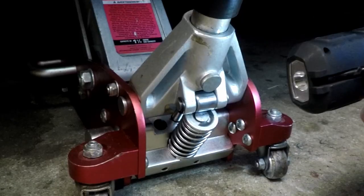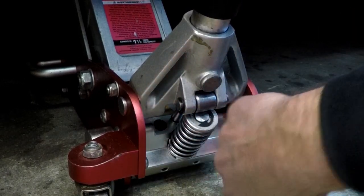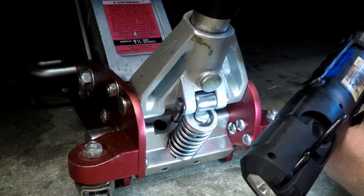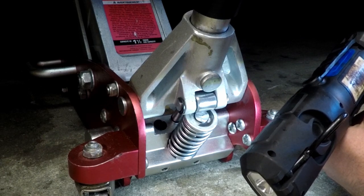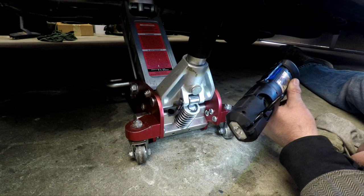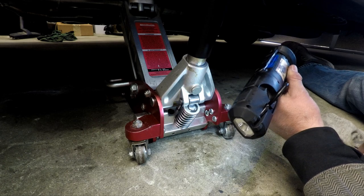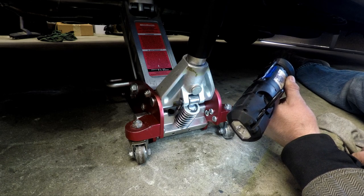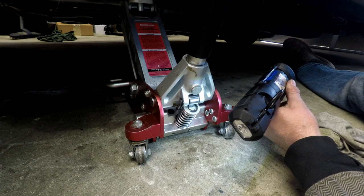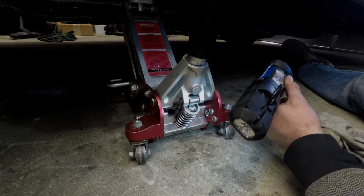It's the next day now — just kidding. Looking at the area again under some real focused light, I don't see any leakage — none whatsoever. So I think it's a success. That's basically how you change the seals around the pistons on these little jacks and give them a renewed life. A lot of people may throw these out, but all they need is a 10-cent O-ring to be good to go. I'll monitor this jack and continue to use it. Before, there used to be a considerable puddle underneath after five or ten minutes of load; now it's absolutely bone dry.